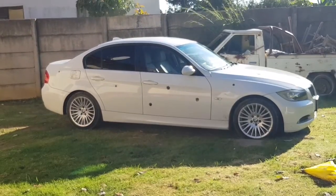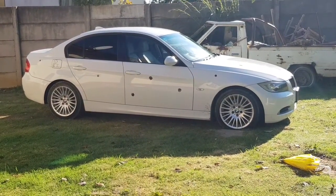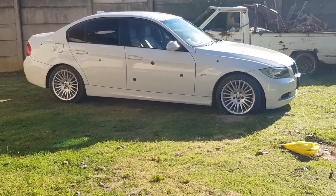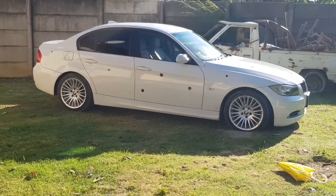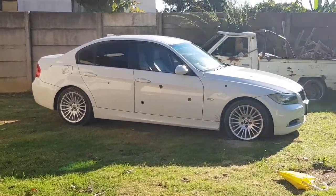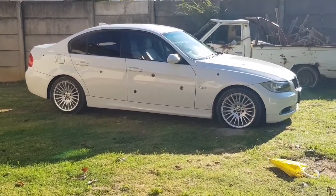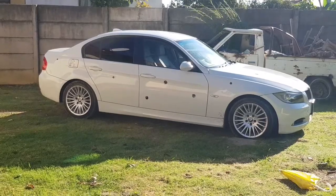The first thing to do is take off the wheels. I personally am of the idea that you do a better paint job when wheels are taken off rather than painting them on the car. So the first step is taking off the wheels, then washing them, then we start to sand them. Like guys, in any paint job, the most important part is the preparation. When you are sanding down and cleaning, it's the process that makes the paint stick better and last longer — that's what makes the paint job great.